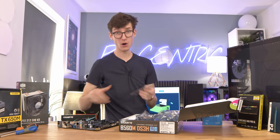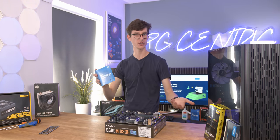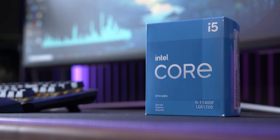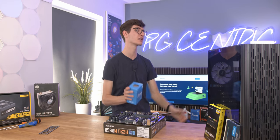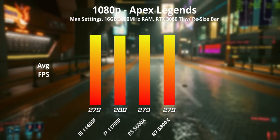Take your motherboard out of the box, grab the IO shield, and gently place your motherboard on top of the box. The first bit of installation is the CPU — it's an Intel build this time around, and here we've got the i5-11400F. This is fantastic — it's got six cores and represents brilliant value for money, and this is pretty much the best gaming CPU for bang for buck right now if that's your priority.